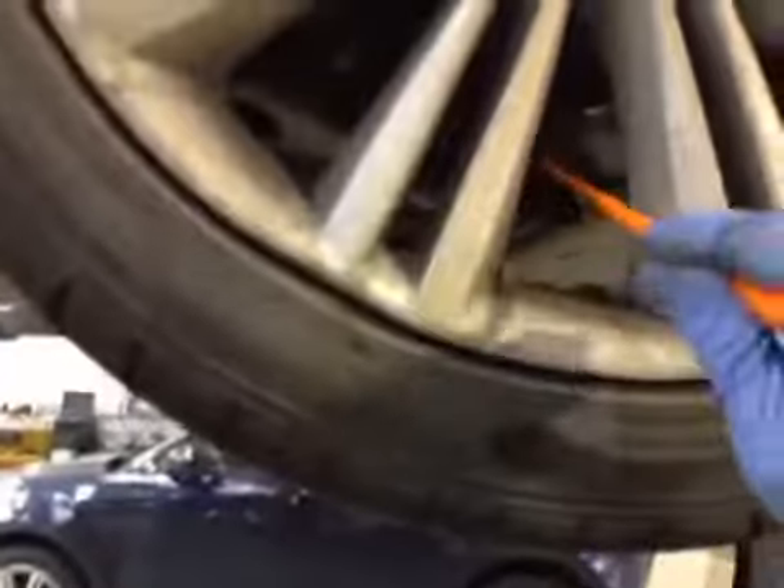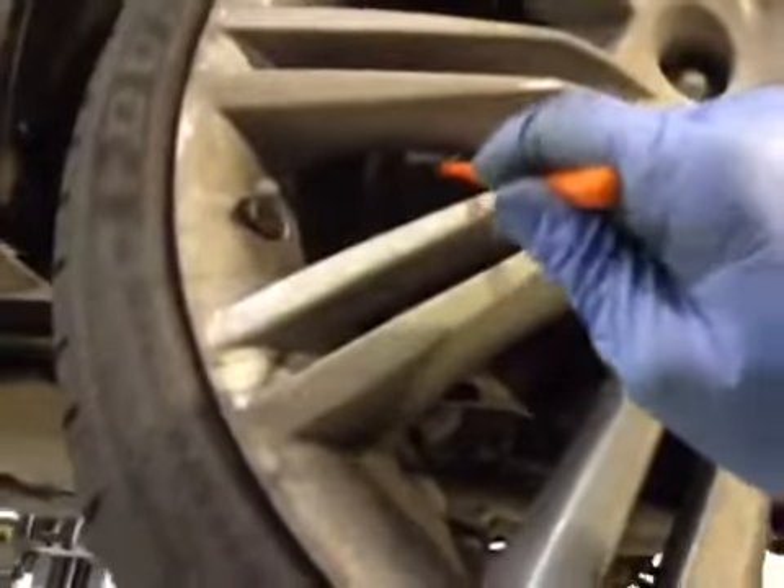This is the passenger side rear suspension, all looking good. Passenger rear tyre is just over 5mm worth of tread. This tyre is in green on the VHC. Your rear disc is in OK condition, and your rear brake pads are roughly on about 7mm. So the pads are in green, disc in green, and this tyre is in green on the health check.